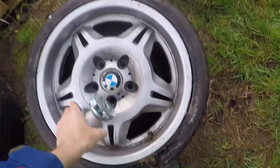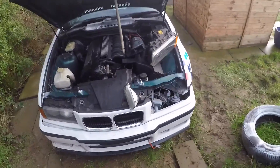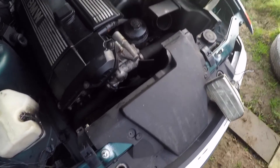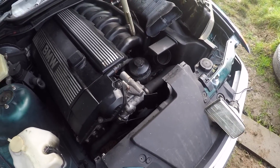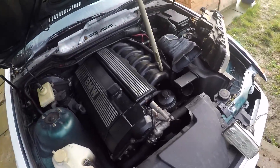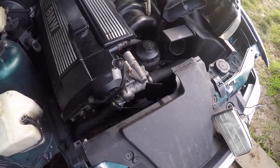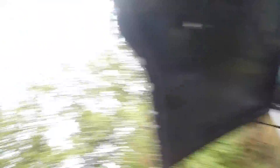This shouldn't be a hard job, especially because I'm getting the fan out. For the clutch fan, you've got two options really — you can buy an OEM replacement, or you can wire in an electric fan. I'm in two minds here. I like the concept of a clutch fan because it's sort of always on — you don't have to worry about any temperature switches or turning it on with a button. But on the other hand, they do fail, they do rob you a little bit of power, and it's nice when you actually turn on an electric fan because you know it's on.